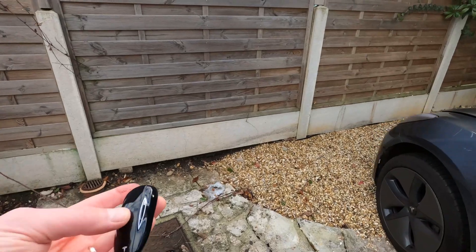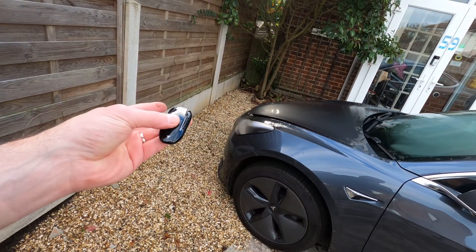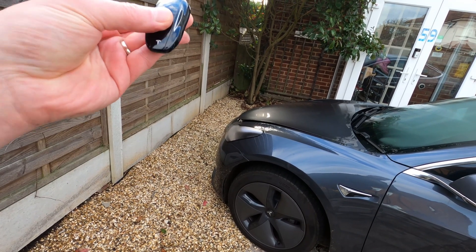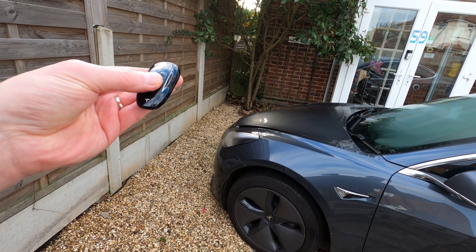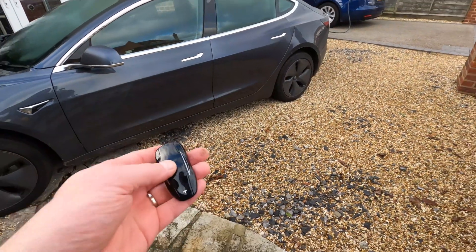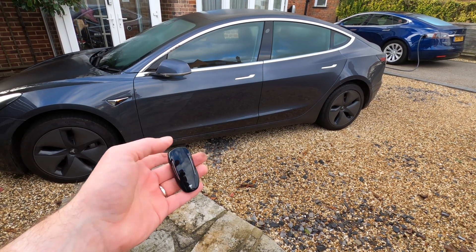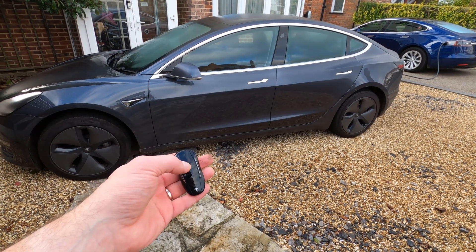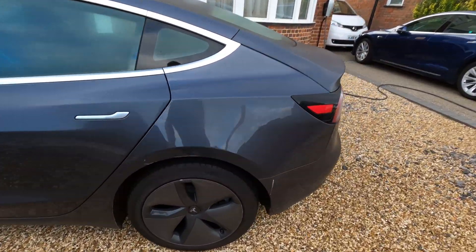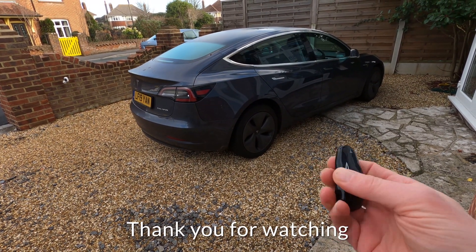The other advantage of this key over the existing ways of getting into the car is you can switch passive entry on, with extra security — the key will go inactive and go to sleep if it hasn't been moved in five minutes, so you won't get passive entry if the key's asleep. You can also lock the car just like with any other Tesla by one press and unlock it with a double press. So it's just like all the other Tesla keys in that respect. There's the summary on what the new key does for the Model 3. Thank you for watching.